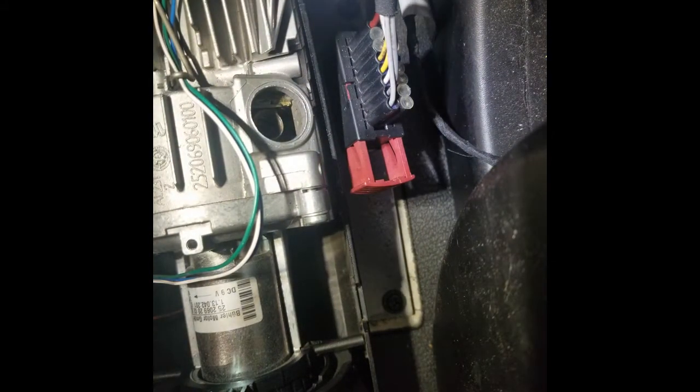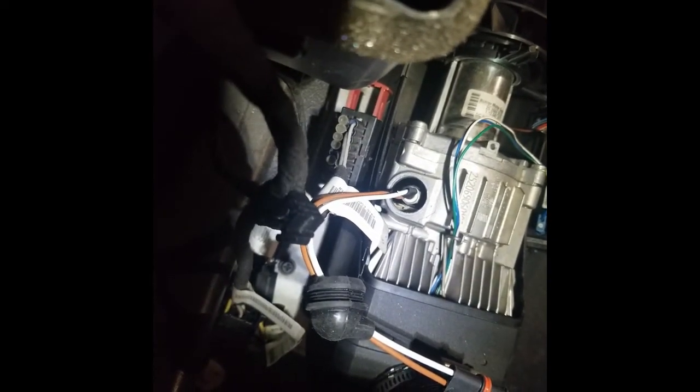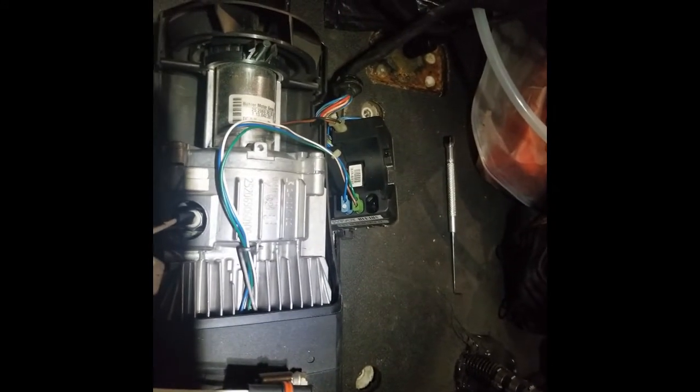Next is going to be to really carefully put the glow pin in. I got it in there — it was about five to seven full rotations to get it all the way in there, then I set it. You really got to get your socket down in there deep, make sure it's square — two-handed job. Make it snug. Then plug it back into the key port there. Put that back on, set the grommet, and make sure you set your screw — that's super important.